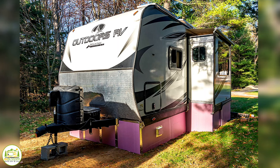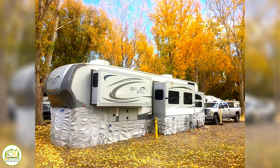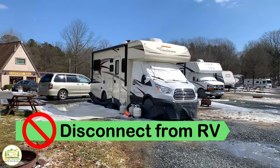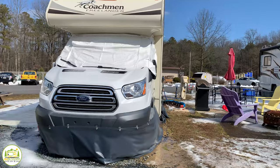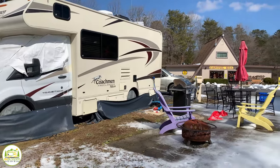For those of you who don't know, there are many different types of skirts out there on the market. There's the DIY type where you install it yourself — you might buy foam board or some kind of material, tape it, snap it, somehow get it onto your RV. Then there are commercial nicer PVC brands where you have to drill a million holes in your RV and snap it in place. But there are several problems with either system — neither one has any insulation value built into it. It's just a piece of material, and it's not very insulative.